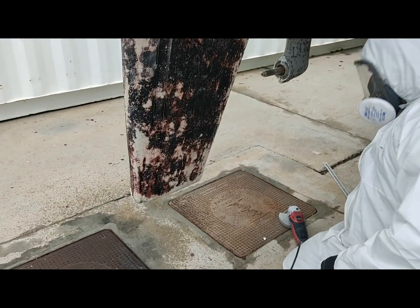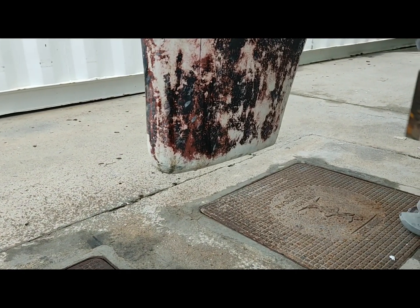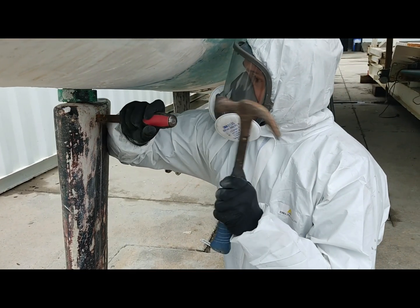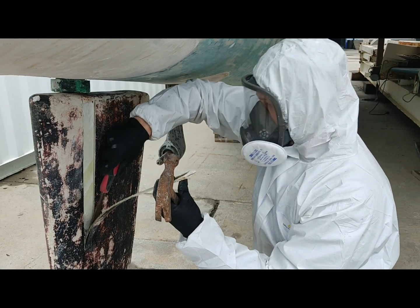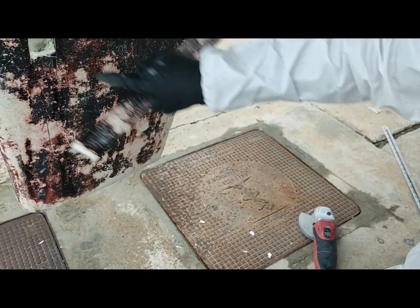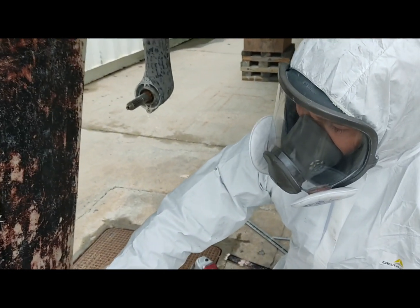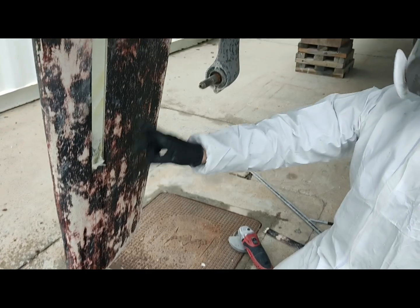Why is there water coming out? Because there's water in the rudder — it's pissing out. Not too surprised. So what's in there? That's bog. They don't use foam, they just fill it up with bog. It's all full of water. How did it get full of water? You can see the repairs on the bottom here — so it would have got smashed, because the bog is really brittle, it just cracks up, and the water just sucks up into all the cracks.